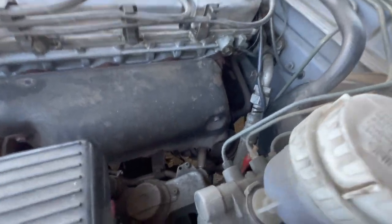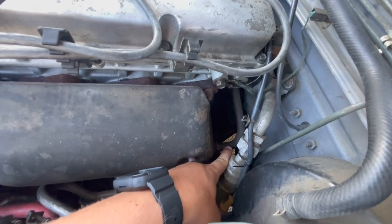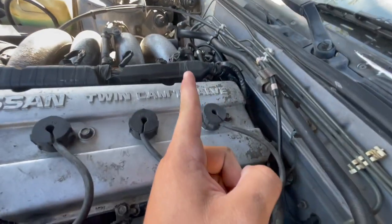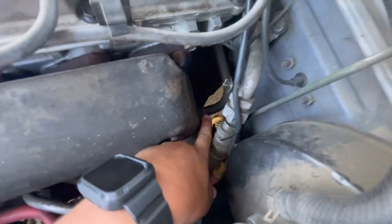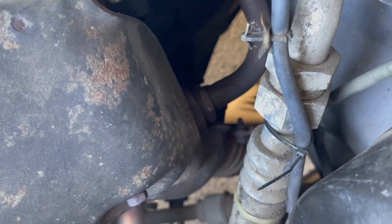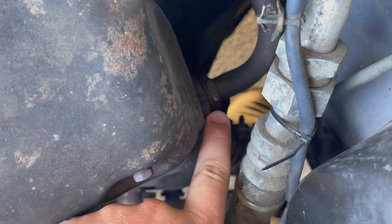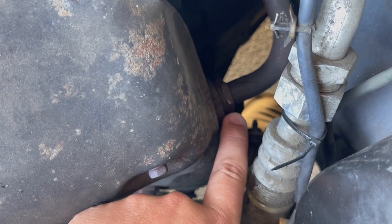If you follow me into this side of the engine bay, we have the exhaust and this tubing right here is your EGR tube that runs behind the block into the actual solenoid over there, and it runs right into your exhaust manifold. This is where the 24 millimeter wrench is going to sit. You're going to want to soak in here with that penetrant and let it sit — do a couple coats if you need to. This is going to be basically rust-welded on there because of the heat cycles.